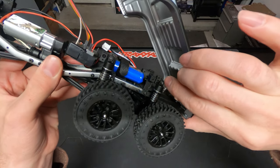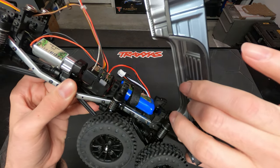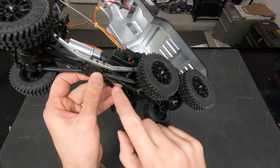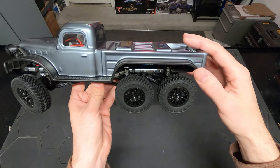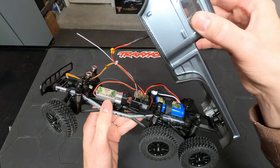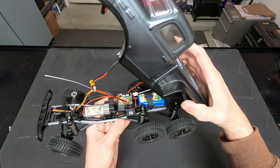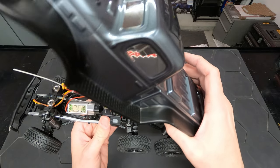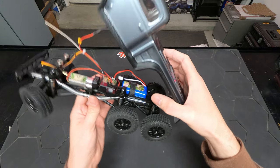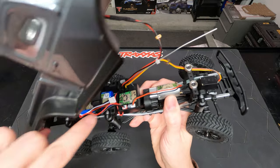The front and rear suspension posts each have about six different shock mounting positions, which is nice. You could potentially drop the suspension to the frame, get some longer linkage arms, and allow it to drop down and lift the vehicle up. There's a 60-turn Panda motor and a small transmission in there. It came with a 700 milliamp-hour LiPo battery, which is very nice — a lot larger than what comes in the SCXs, and appropriate given the extra axles and heavier build.